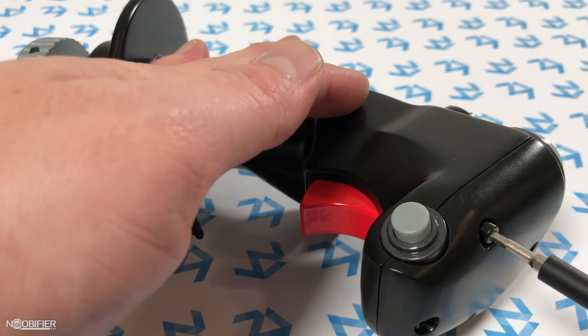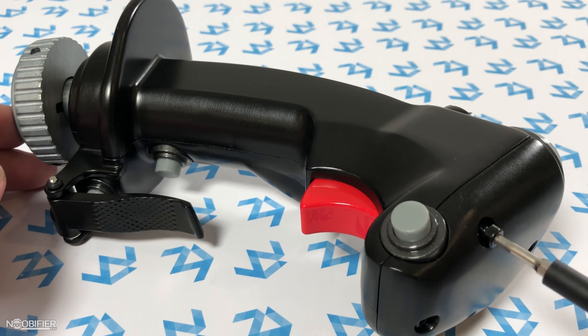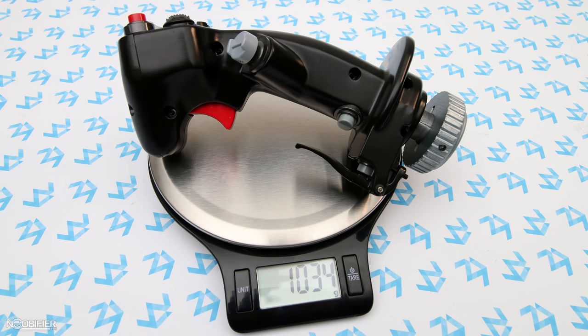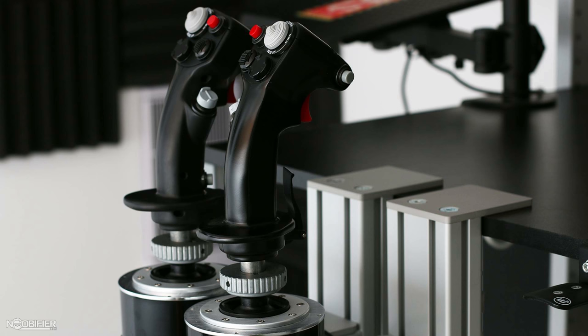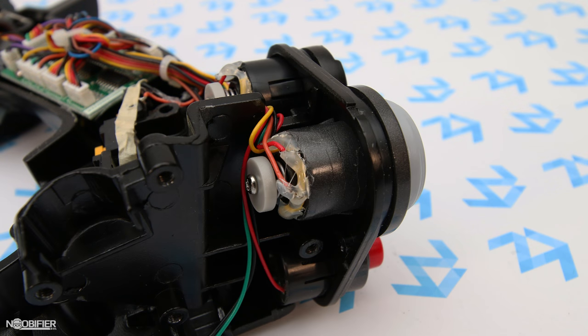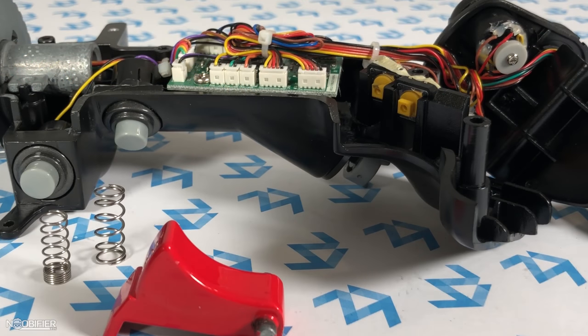The design is showing its age, but unless you drop it out of a second-story window onto concrete, there's no cause for concern. Most see its weight as a positive, but mechanically it's a liability — placing an increased pendulum load on the gimbal. The further off center you move it, the more force is needed for the gimbal to return it. This means if you prefer a weaker spring, you may need to manually right the grip before releasing it. All switches are mechanical and I was surprised to see the exposed rear of the hat switches. The triggers should last forever through millions of clicks.